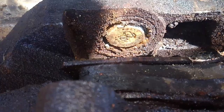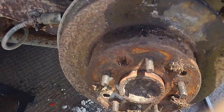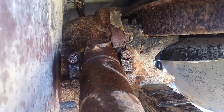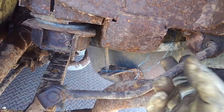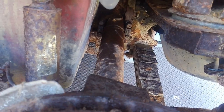There's quite a bit of sticking in there — wasn't releasing those pads — but that's okay. What we're going to do just out of curiosity is try taking these half shaft bolts out. You can tell this is an original big block car — beside the VIN, the VIN on a 72 can tell you — but you can also see it with those heavy duty caps right there instead of U-bolts. I also have a video detailing those, I'll put a link at the top. You can see those heavy duty caps holding the U-joints in, and then you can see that rear sway bar — it's a big block only item, or some of the later 70s cars got some of that stuff.